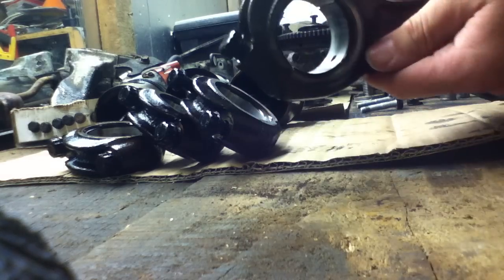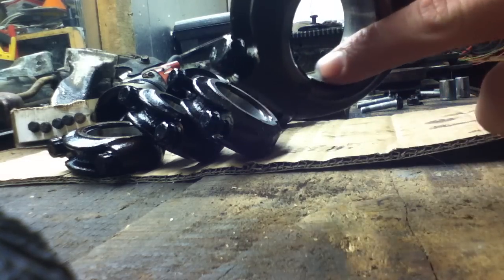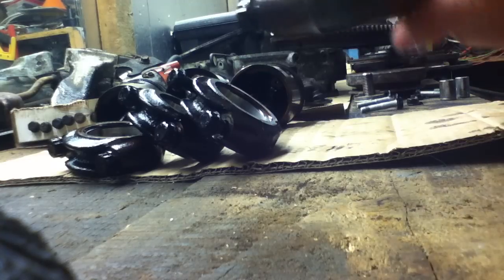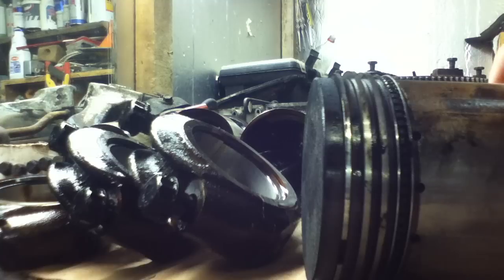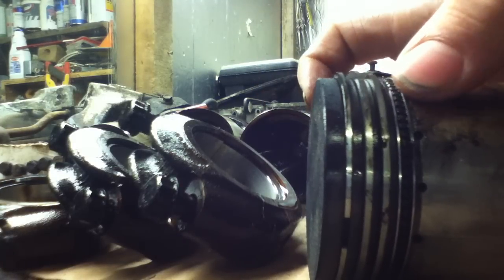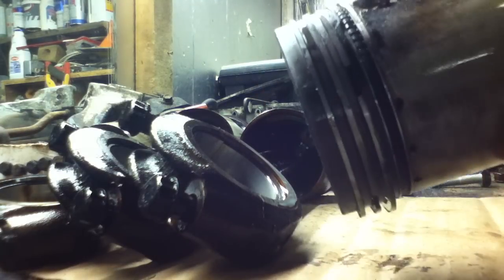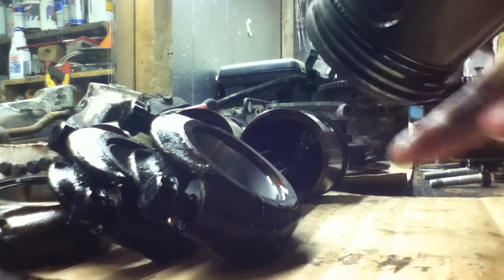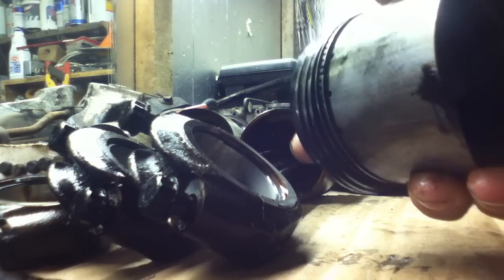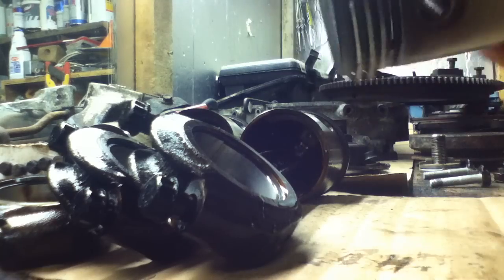As you can see from the shells in there, it's all in very good condition. There's only light scoring, so I've replaced the shells and that should be fine — I'm ready to go back in. From then on it's just a simple case of replacing the piston rings and the oil control ring and giving it a good clean up. I'm possibly replacing the bearing in there but there's hardly any lateral wear on that so that's fine.